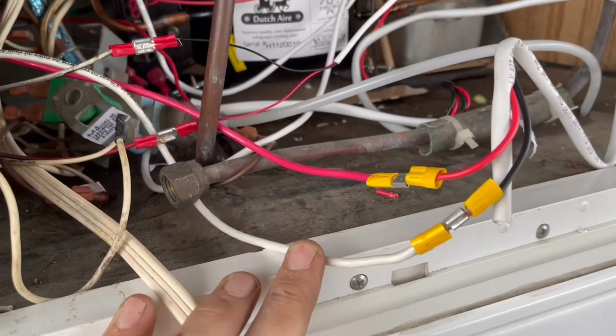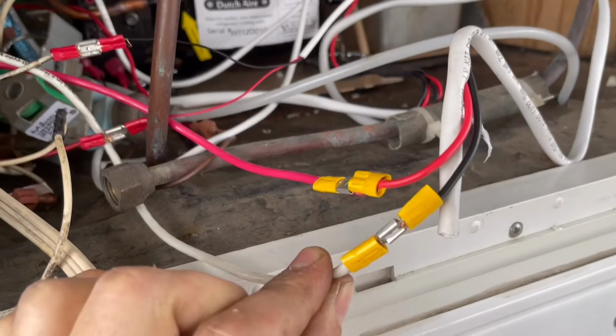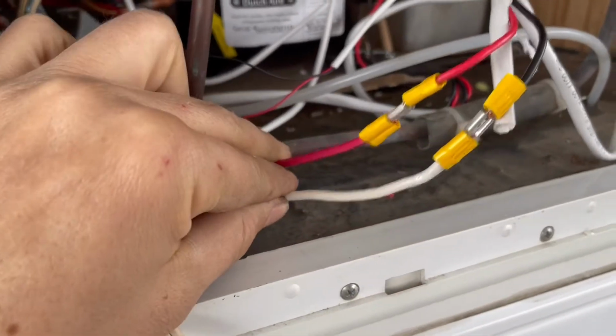In another one of those nothing-ever-goes-according-to-plan moments, I thought I had everything done, and suddenly I'm getting a no FL error on the fridge when I try to turn it on. And the new controller on the new cooling unit is clicking. It's probably something simple, but I don't know what it is. I thought I had everything else ready to rock and roll here, other than a few cleanup actions. I still need to clean up the wiring, but basically this is the power from the new 12 or 10 gauge wires to the fridge.